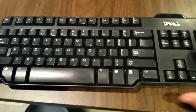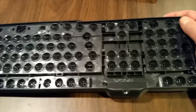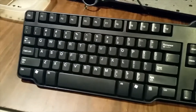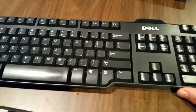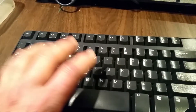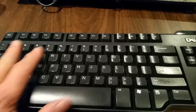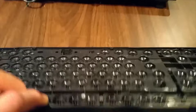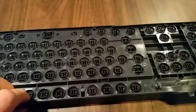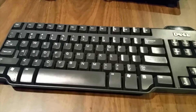Anyway, plastic — go put it in the utility sink. Scrub this bad boy down if you need to. Get lots of water on it. Flush that gooey orange juice off of here. Once you've gotten it cleaned up, use a scrub brush. I have literally used a scrub brush on keyboards. I reclaimed some keyboards from a veterinary clinic — there was dog hair and cat hair down inside underneath all of these keys. It was a mess. If you need to clean underneath these keys, they can be popped off fairly easily and then reinserted. Make sure that you put them back in the standard QWERTY order. Once you're done scrubbing the keyboard clean, it's important to get it dry. You can shake it, pat it down with a towel, or take your canned air and spray the water out of it. Just let it sit for a day or two. Shake it occasionally and make sure that it's dry.